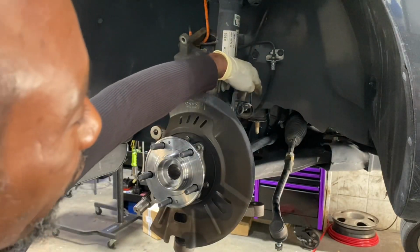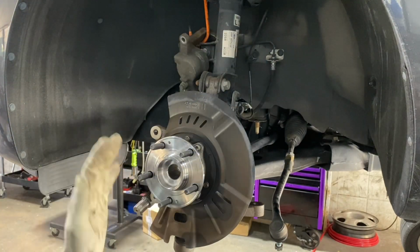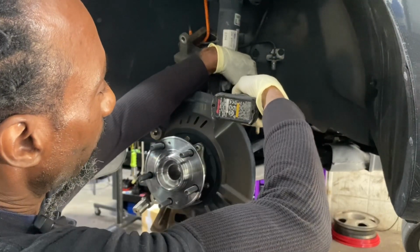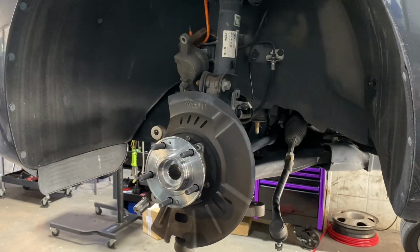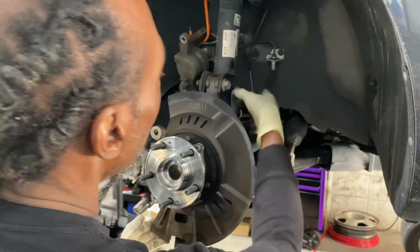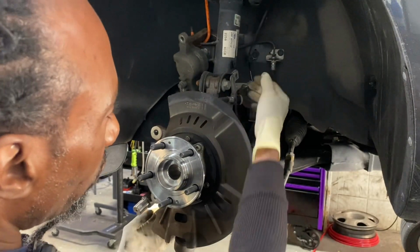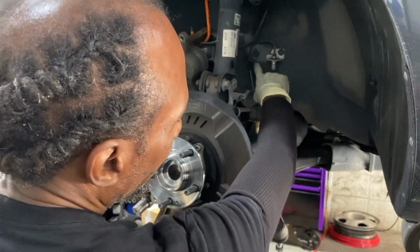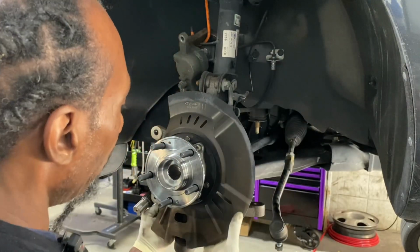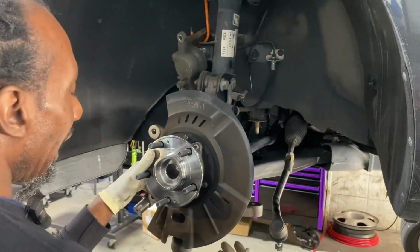The best thing I could tell you to do is there's a 12 millimeter right here on a bracket. You could move the bracket and everything comes free. I think I'll do that. The only reason why I'm doing it is because I did take notice of this wiring here. When I pulled it forward, there was just not enough clearance. There's another 12 millimeter bracket piece here if you need more to come forward. So we're gonna try to see if we can get our axle back in here.